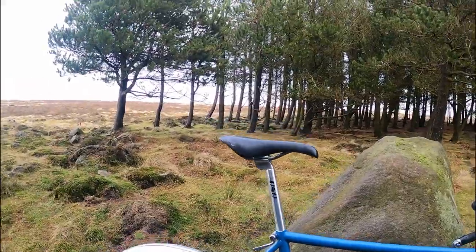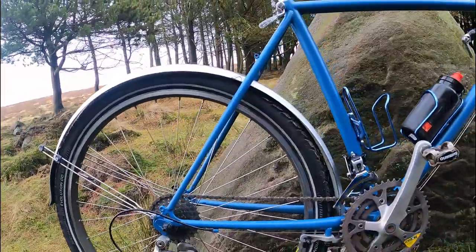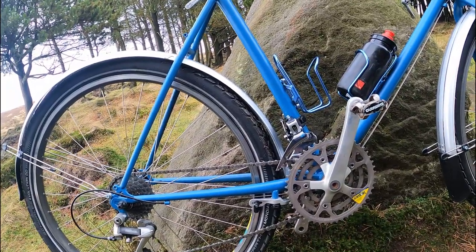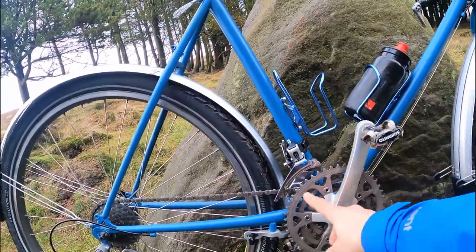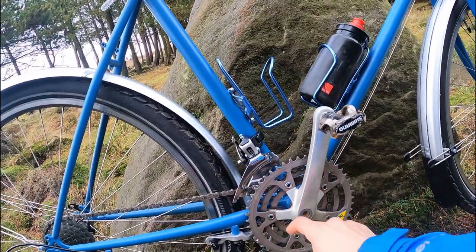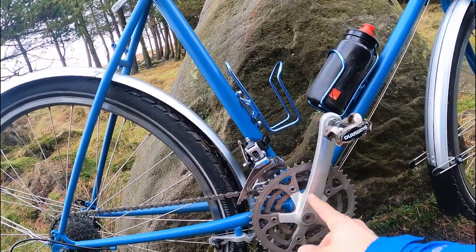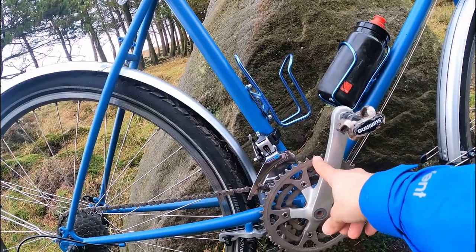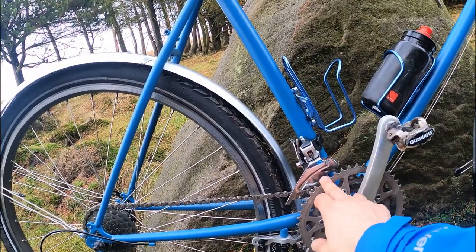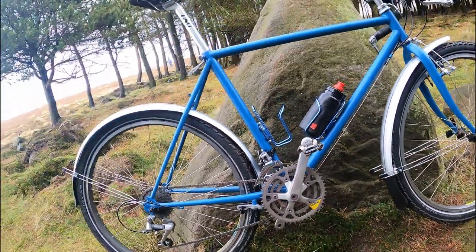As you can see it's looking really good. Friction shifters, a new stem and a new seat post — I've still got the original saddle on, which is a bit bad. I just bought some new U-brakes, old BMX-style, because I misplaced the others. I am going to get a different crank off eBay because this ovalized chainring is difficult to set up properly with the derailleur — it has to be set high, and when it gets to its highest point on the oval it touches, but on the lowest part it's too far away, so you don't get clean shifts.